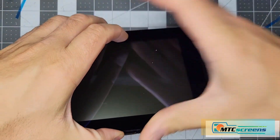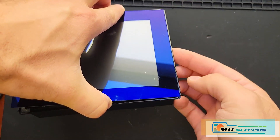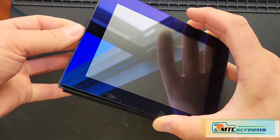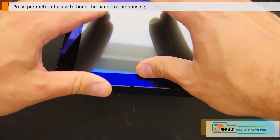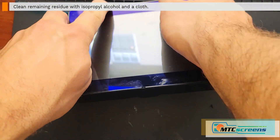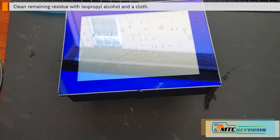If all is well, pull the unit out, remove your temporary tape, gently lift up on your LCD panel — just a quarter to half inch above the surface. With one hand balancing it, reach in, grab those little blue tabs and expose the tape — right side, top, bottom, and then the left side. Now the tape's exposed; as soon as it touches the plastic it's going to be very sticky, so align your right edge again, avoid the digitizer wire, don't pinch it. Press the perimeter to tightly bond the new panel to the housing, and clean up any residue or fingerprints with isopropyl and a paper towel. Your panel is tested, installed, and ready to go.